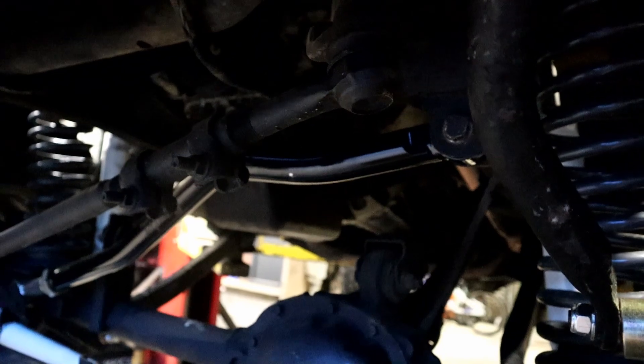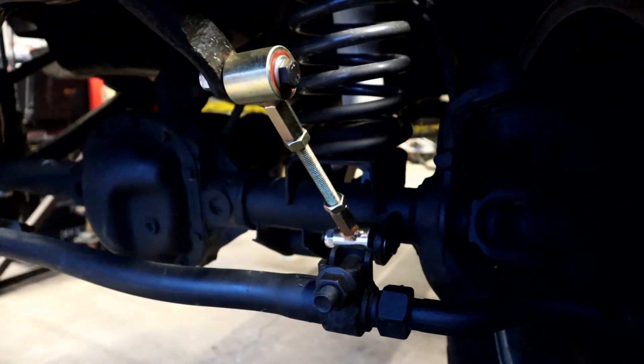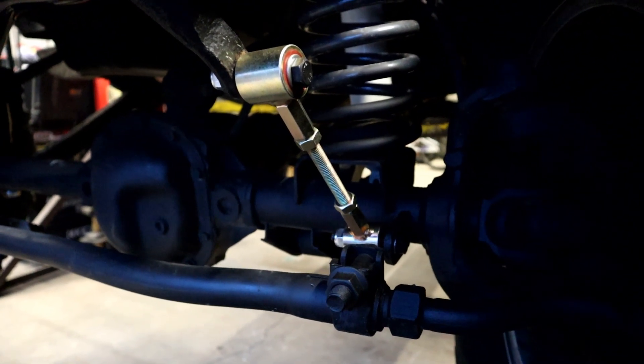This is your steering gear — you can't see it real well, but you can see the angle right there. A lot of people try to change that out and drop it; I wouldn't suggest doing that. My joints are good here so I'm not going to change them. I also opted to go ahead and change the stock links out with new ones, because I found that contributes to death wobble. I decided to keep my ball joints since I tested them and they seem pretty solid, but worn ball joints can also lead to death wobble.